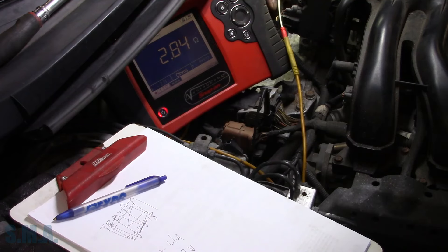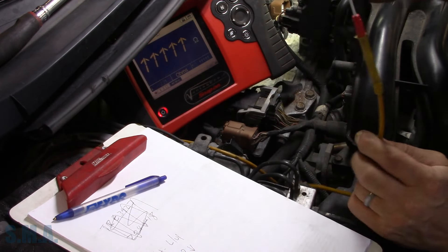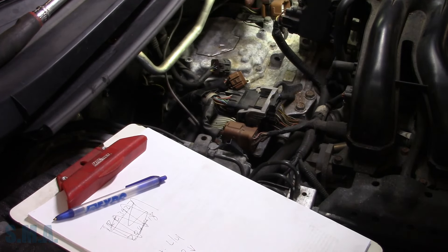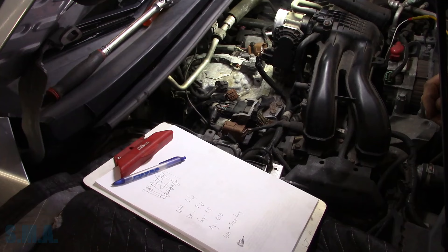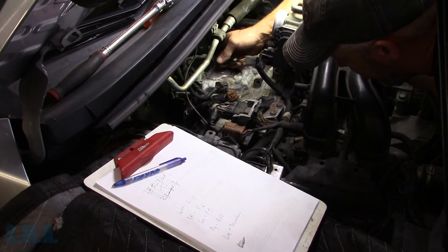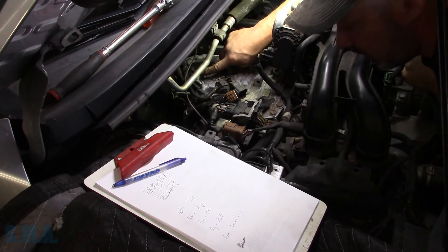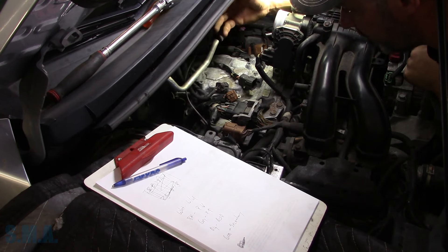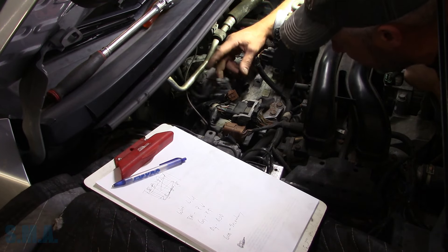You can see why the computer is throwing a fit. Now that we've verified that solenoid is shorted — or close to it, the windings are getting tighter — we could potentially have a short here in this harness. This solenoid goes around and into the top side of the transmission, so we have to pull this wiring harness out, because it's not part of the valve body assembly. We could, in some weird circumstance, have a partial short pulling it down to 2.73 ohms, or we have a bad solenoid.